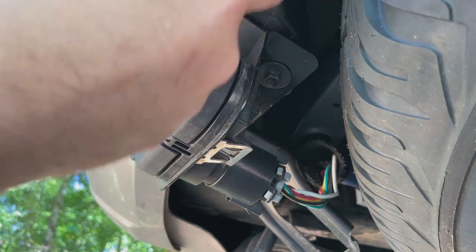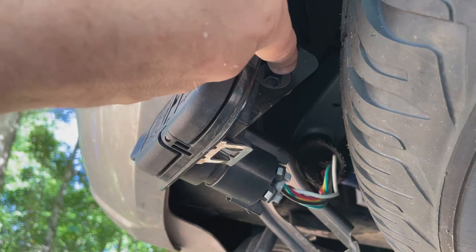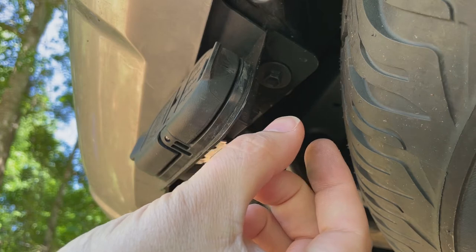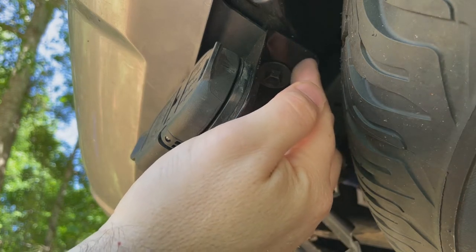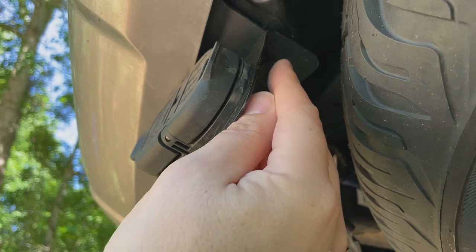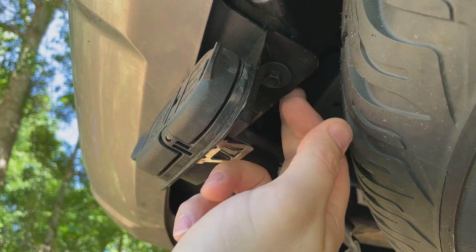This bolt here is actually a Toyota bolt — it goes into this big bracket and holds the bumper plastics in place. The bolt has a little bit of a shank on it that's a little wider than the actual threads back toward the washer. You have to drill out this bracket a little bit to get that shank to go through so it'll get flush up against the washer and tighten down into the threads.